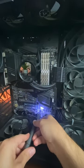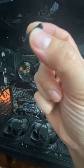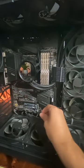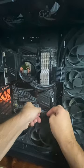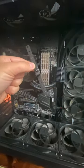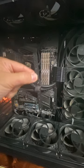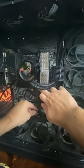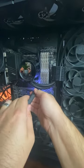First, remove the motherboard screws and then screw in the standoffs it comes with. You can move the L-shaped bracket wherever you need it, so it works with all GPUs. Then just reuse your motherboard screws to hold the bracket in.